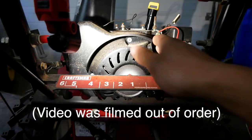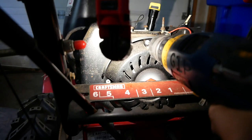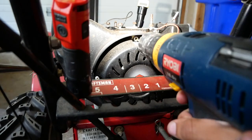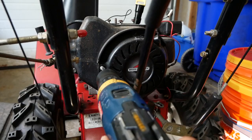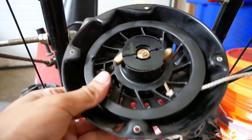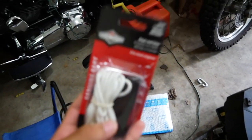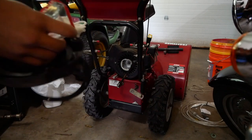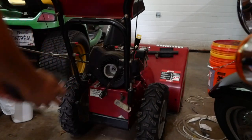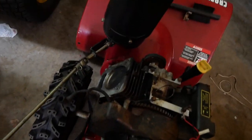Let's handle the broken pull cord. These model Briggs are held in with rivets. Get yourself a drill and you're just going to drill it. Step up drill bit sizes until eventually this outer ring here is literally just going to fall off. And off she comes. Since the end of our string is broken, you just pull it right out. Perfect working pull cord.